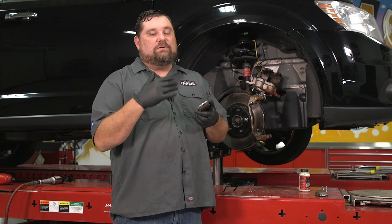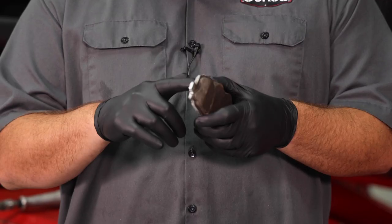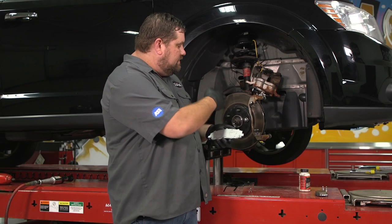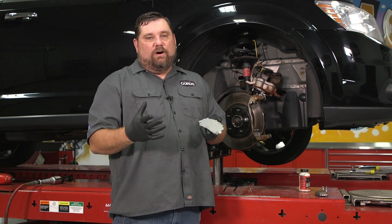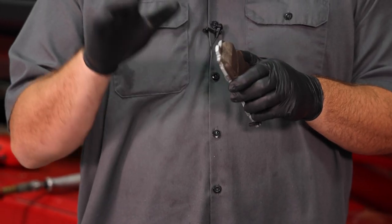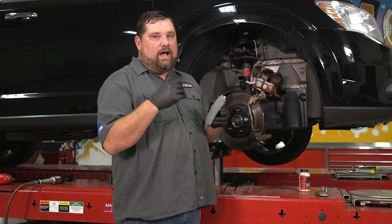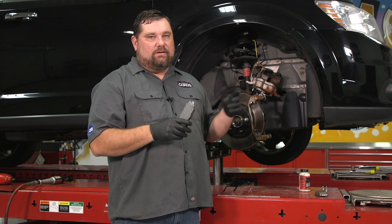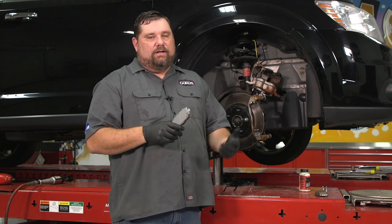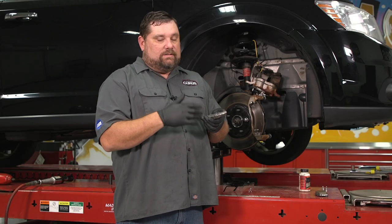I'm going to show you the technique I like to do, which entails putting the lube where it actually belongs — straight onto the caliper itself, because that's what we're concerned about. We will also put it on the T-heads on the pad. I've already put just a little bit on the abutment clips when I put the bracket back together, so I'll put a little more here — not too much, because if I get too much when I slide this pad in the bracket, it'll squeeze all that grease toward the rotor and I could end up contaminating the pads.